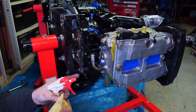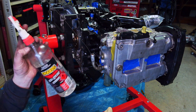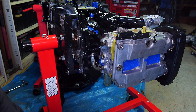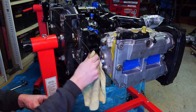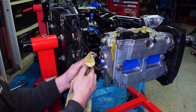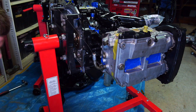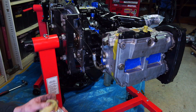The next step — with a clean microfiber rag I'm just using some wax and grease remover to clean this surface up as clean as possible. You could also use methylated spirits, acetone, or any kind of thinners — any alcohol-based thinner works really well. Now I'm just going to do the same thing to the inside of this fitting, which is going to be JB Welded as well.